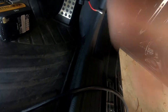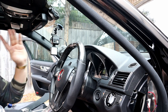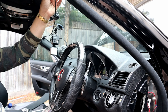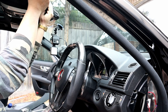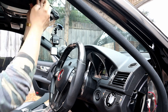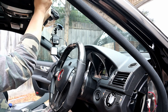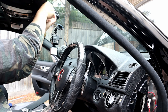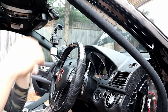Now that we know the camera will go here, this is the power cable for my dash cam. I've run it along the top and you tuck it behind the roof lining — if you put your finger in you can feel there's a thick point of the roof lining. All you have to do is tuck it in behind that thick panel, then run it to your camera and measure how long your cable is going to be.